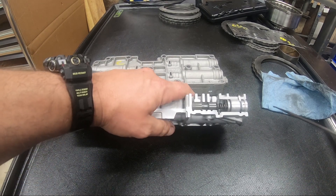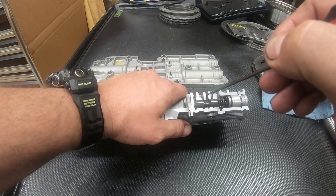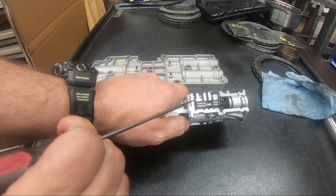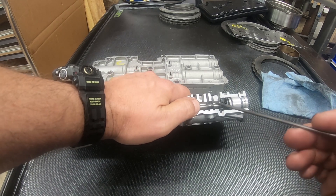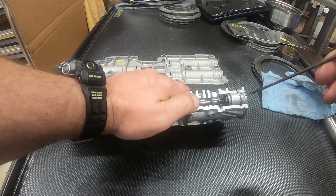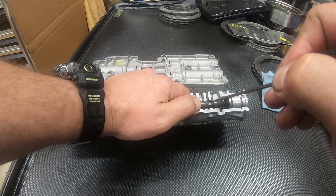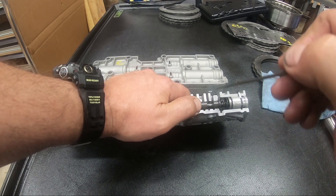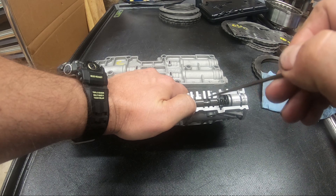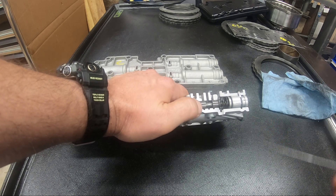This pressure wants to push this valve this way. Now this modulated line pressure is also looped back against this piston on the back end — that's what's giving this resistance. So if this modulated line pressure exceeds what our EPC force is applying, this valve is going to go that way and dump some modulated pressure off into the exhaust port. Then this valve will slide back to the left, reconnect the line pressure to the modulated line pressure port — and this is how it's modulated. This valve does this all day long; it probably never stops moving.